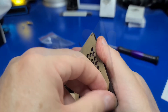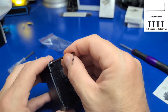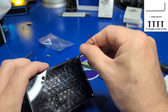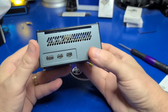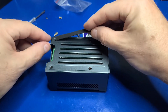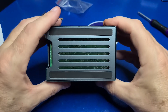Remove the protective backing from the acrylic top panel on both sides. Place the panel over the top of the case and, using the allen wrench and four hex screws, tighten the acrylic panel down on all four corners. It's easier to start with the longer end of the allen wrench to get the screws started, then use the shorter end to tighten each one. Once done, flip the case over, remove the protective backing from the rubber pads, and place them over the indented area on the case to keep it from sliding on your desk.